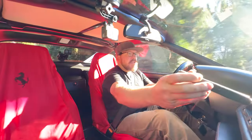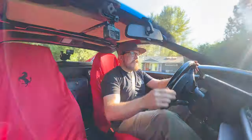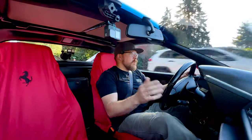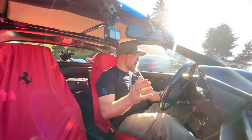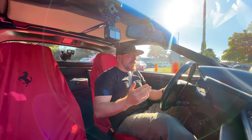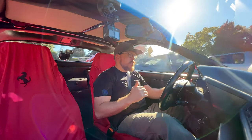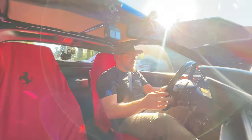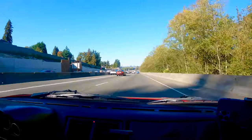We will check our AC. We're blowing 58 degrees, so it's getting a little chilly. We'll try some different vent positions here, and we really want to make sure all of our vent doors are working and make sure our AC gets the temperature, especially since we will be evacuating the AC on this car in order to get the engine out. We want to be sure that, again, it's operating the same way when we return it to the client. So we'll just get on and cruise.